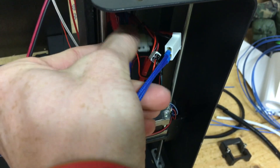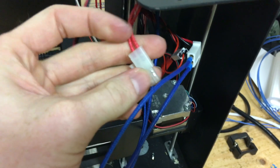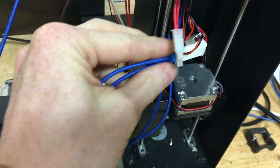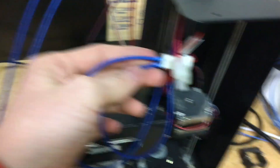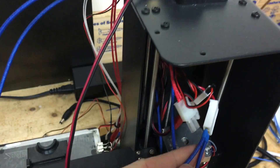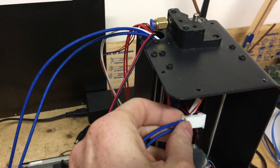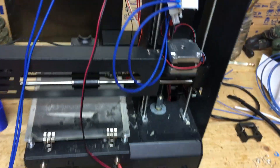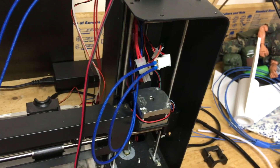And here's the heater cable. It normally is a plug connector, but I haven't quite figured those things out yet. The cables inside are replaced — it's plugged in like this. That's how one of our earlier builds is wired as well. So now we test out all the cables and check that the heater is working correctly. Then we can start wiring it all back together, cable management, and putting the Z-plate back on.